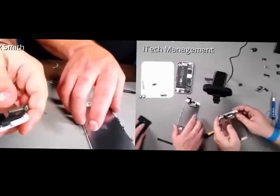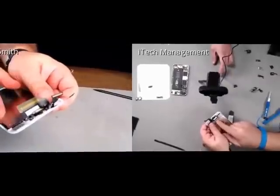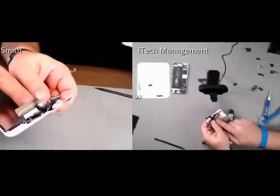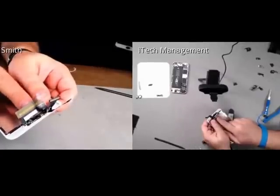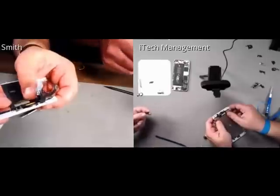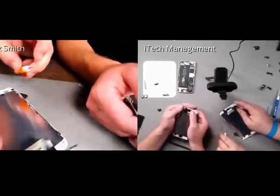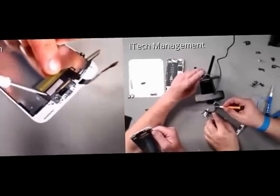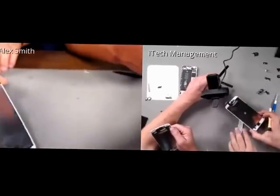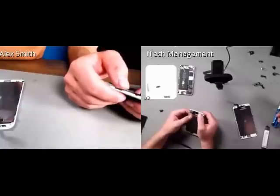So what you're seeing here on this end, this yellow strip right there, is actually two cables that are married together, and it's most likely the same type of conductive adhesive they used in the iPad 2 cellular models, which is kind of interesting. And then over here is where your backlight cable runs around and is soldered down and then covered with a piece of adhesive. So, Ed, is it possible to do a display assembly switch with leaving the proximity sensor and ear speaker in on this?